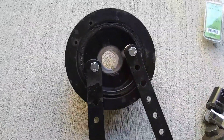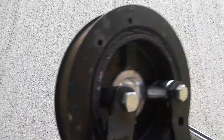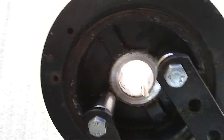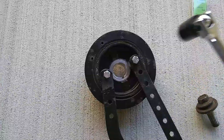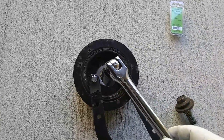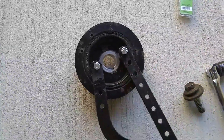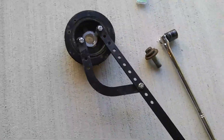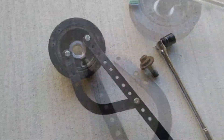These bolts are semi-tight and they will prevent — with the spacers made out of sockets — they will prevent the pulley from turning. Then I had to use a breaker bar with a cheater pipe to be able to move this bolt. But it worked. I also used the tool for the timing belt pulleys, and I'll show you in a moment how.